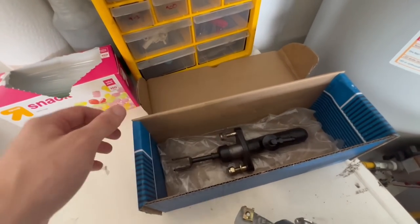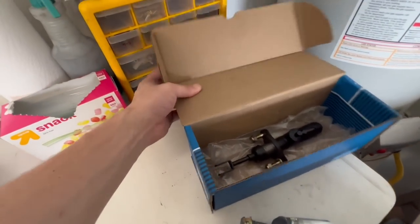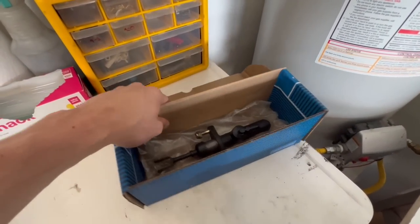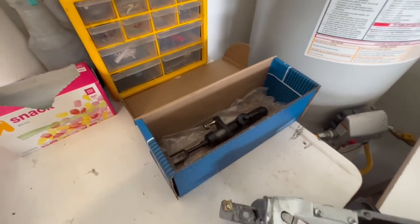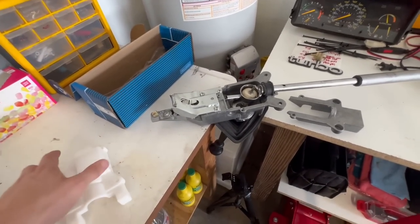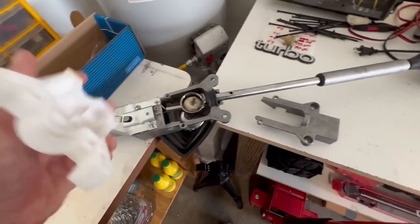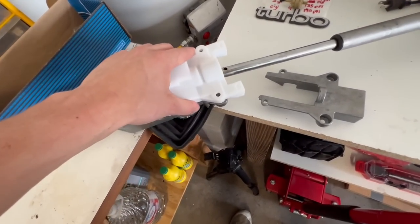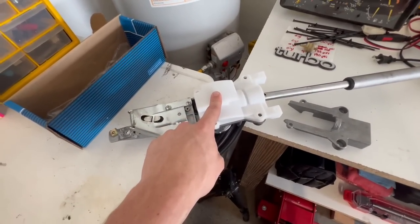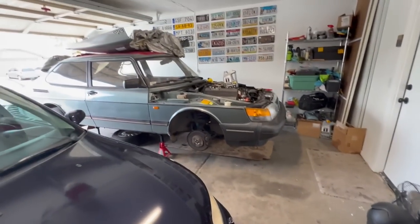Back to present day — I've got my couple of new parts. Right here we have our master cylinder; eStop Parts didn't have these so I went on RockAuto and was recommended the Sachs master cylinder, which was about 60 bucks brand new. We also have the bracket I mentioned — the automatic and manual versions are different, so this one will fit right over here and seal properly as it should. Three things we've got to do now: finish putting the shifter together and install it, put the new master cylinder in, and bleed the clutch and fill fluids.